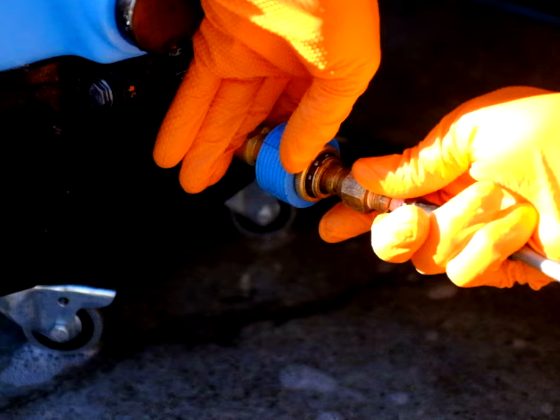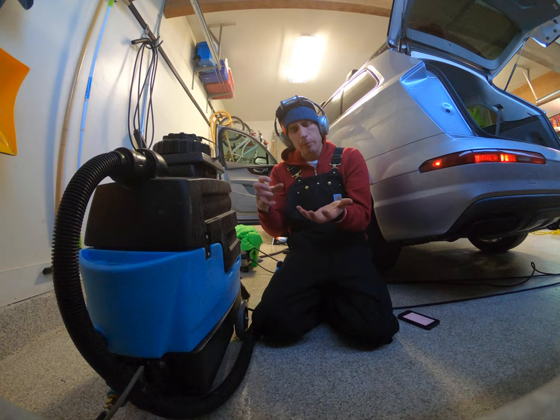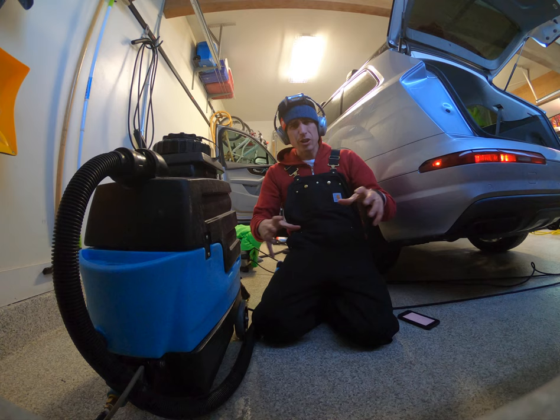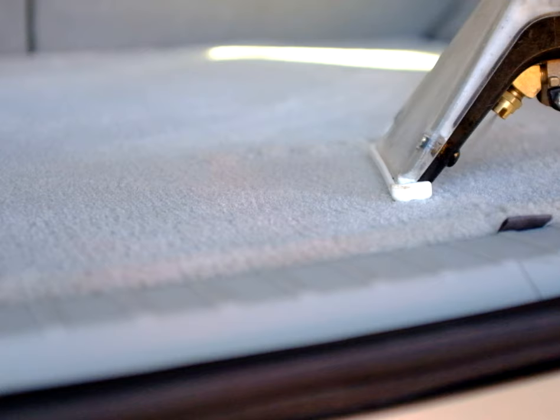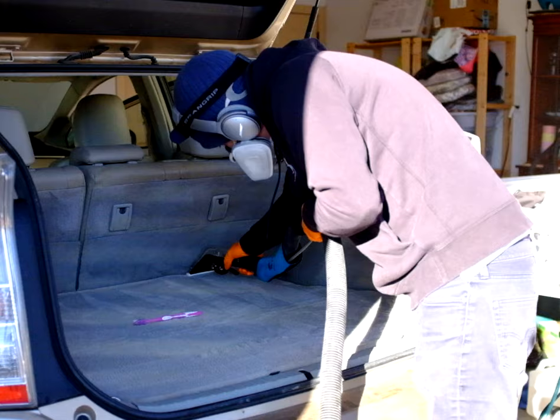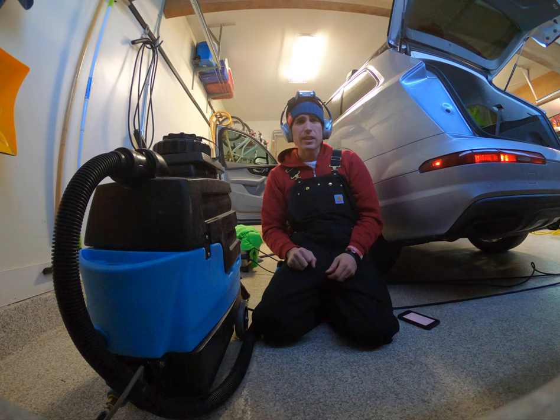How about seats? Have you ever dealt with cloth seats and all of that moisture just wicks back up to the surface? Because with cloth seats these days, all you ever see — a little water drop causes wicking. What if you see a vehicle for the first time and it hasn't been cleaned in five years? Do you know how much wicking is going on with all kinds of nasty things in there? If you're not using something first to break down some of the grease — usually that would be a pre-spray — and then rinsing with an extractor, you're going to have problems.